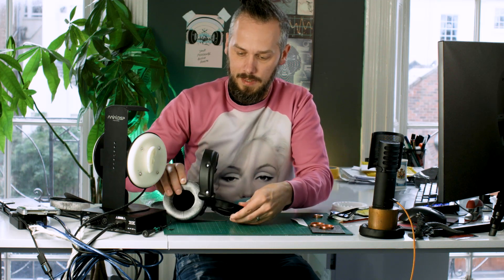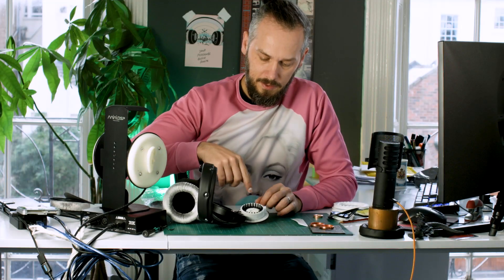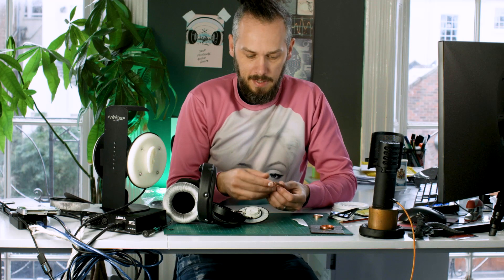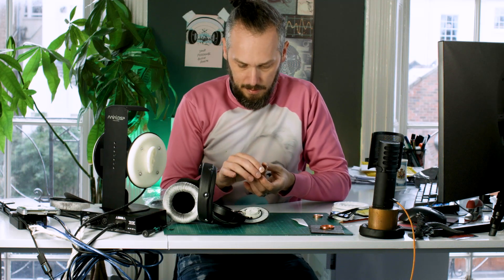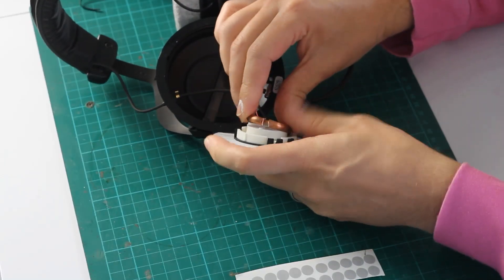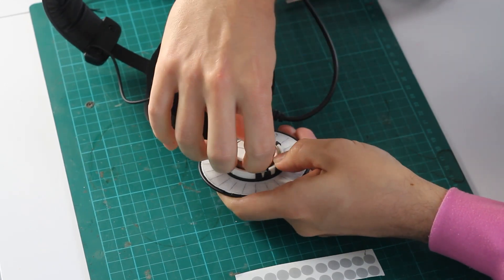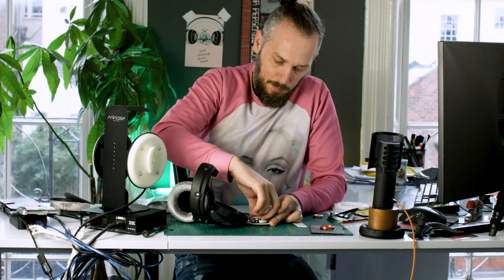So now we have the driver dangling. We're doing the left side because that's the harder one to do. Now inside we have the driver out. Let's just remove this cotton a bit — it just pulls away like that, just gives us a bit more access. Now these will be the things you'll get in the kit, and they've got double-sided sticky tape on the inside. So you just remove the red plastic covering the sticky material. To make sure these clamp on tightly, we've made them slightly smaller than they need to be, so just ease that out a little bit. Then that should go on nicely. Just make sure that's all tightly secured onto that outer section there — the double-sided sticky tape will hold it in place and stop it from slipping.